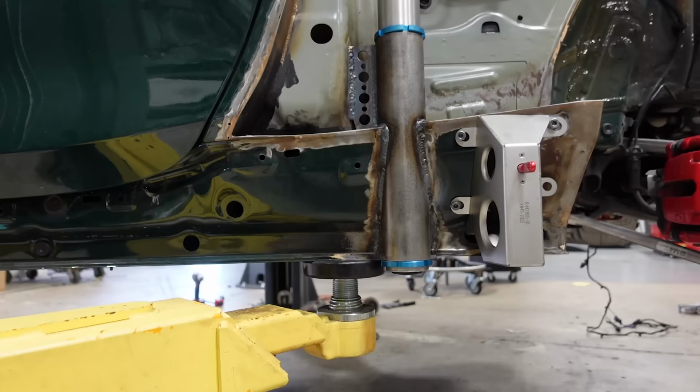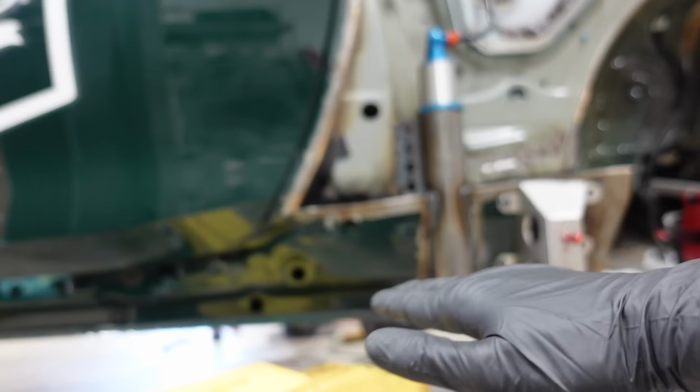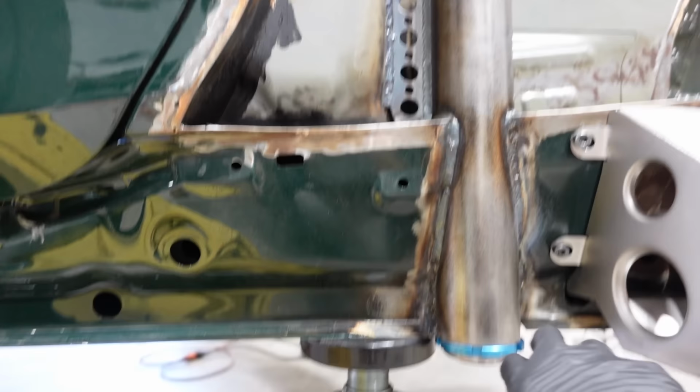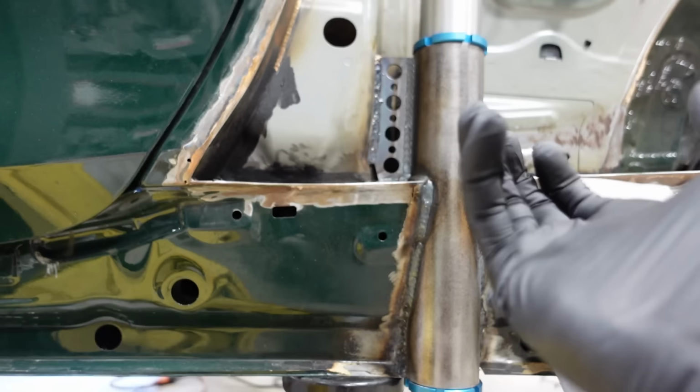There's gonna be some adjusting that needs to be done once we actually get this thing finished. But this morning, Dylan and I went ahead and leveled off the bottom of the jack stands and put a grinder to it just to make the bottom of the peg as smooth as possible. I'm talking about the collar system that holds the actual air jack, not the air jacks themselves, because these are like coilover collars. So you wanna have as flat a surface as possible so there's not a high point and it's only locking on the high point and not mating on the full surface.